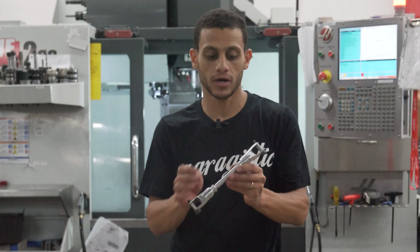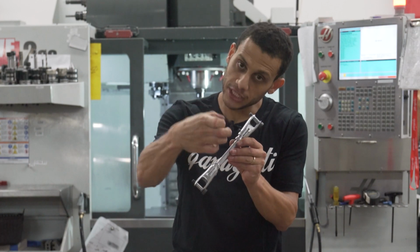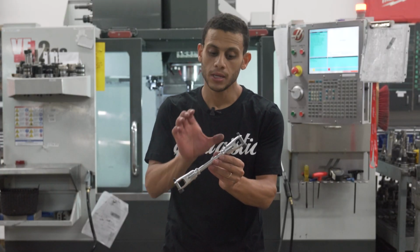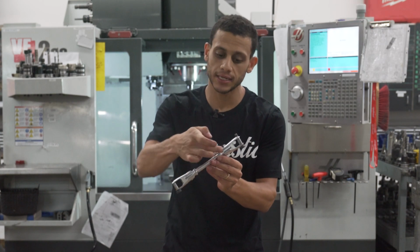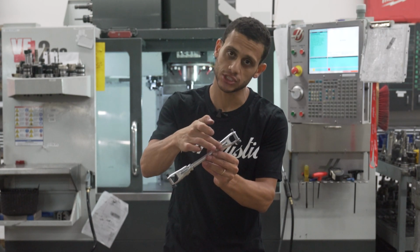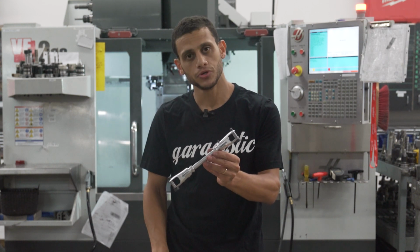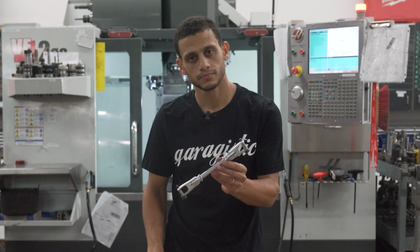The torque specs on these actual Allens that pinch everything, you can see there's a slot. It'll be around 20 inch-pounds as well, but you can feel free to just compress it. All it's trying to do is actually just pinch it. That's why that slot's in there. It's going to pinch everything and clamp it. So that one, you can go a little bit higher than that, but not what I did earlier.